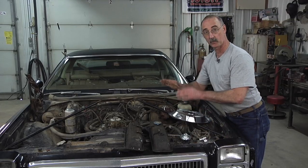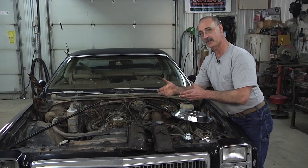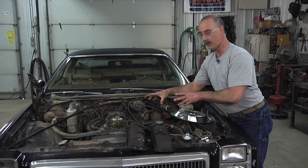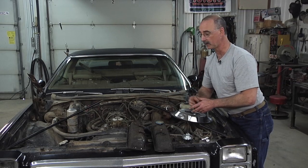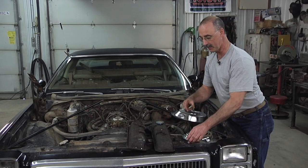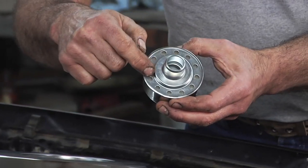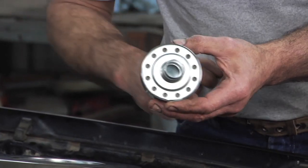So you just have to have a look at what you're doing, how the parts go together, and be cognizant of the fact that when you do an upgrade like we did on this vehicle, there's the chance that you're going to be one hole short — because your oil fill cap is acting as both a fill cap and a breather in this case.